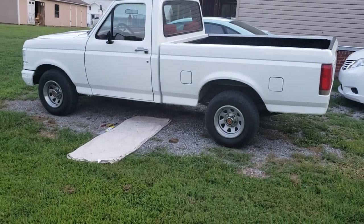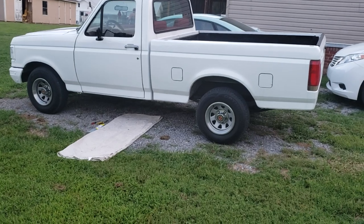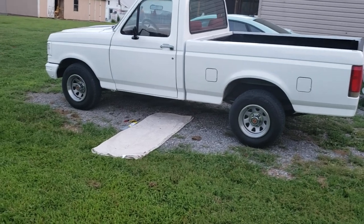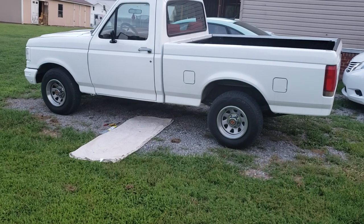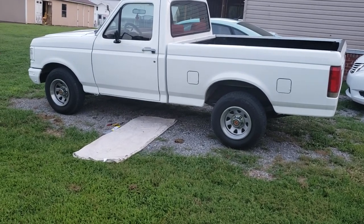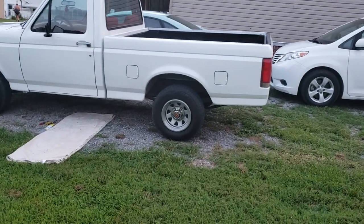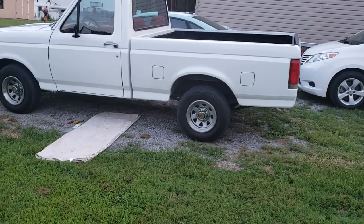When I had the truck painted I had the fuel pump and sending unit replaced in the rear tank, and on the front a new tank pump and sending unit. At that time I also replaced the very expensive selector valve, and ever since the truck's run like crap on the front tank — like it's starving for fuel, not getting enough. And when I use the rear tank the truck runs great, but it also pumps to the front tank and overfills it.